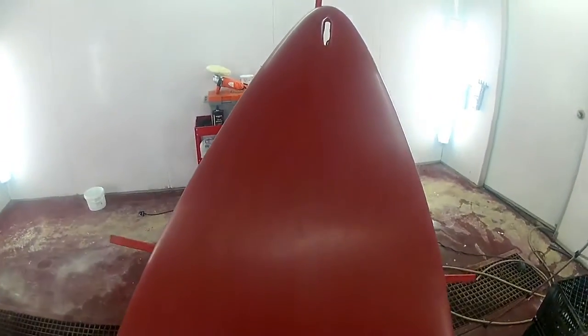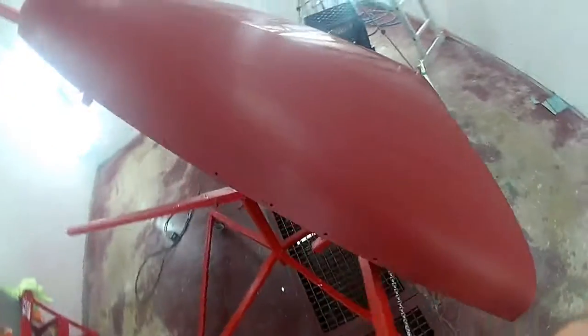Okay, so we finished up sanding with a 2000 grit in the horizontal direction when it's on the car. On visual inspection, we can see there's no cross hatching from the previous grit sandpaper. Most of the orange peel's gone.